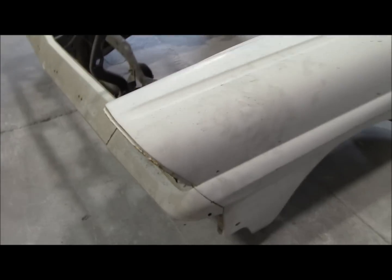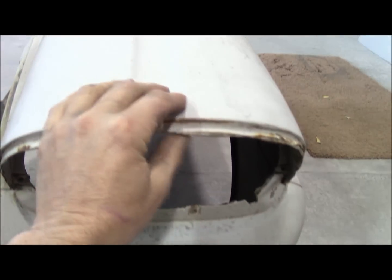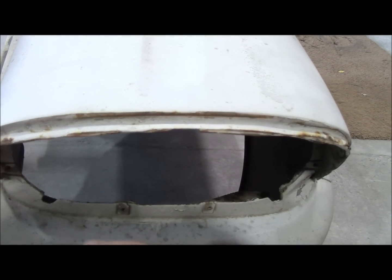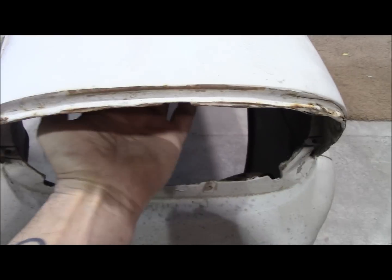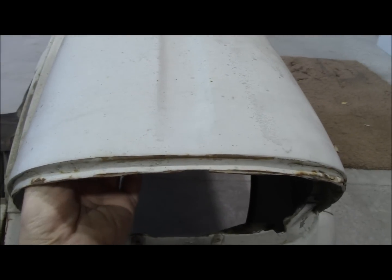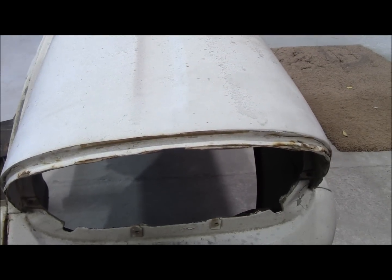What I was going to say is that on the fender itself, on this fender cap, like 55 Chevys and 57 Fords, it's double walled here. You've got your outside fender skin, and there's a lip under here that probably goes back a good two to three inches. It's solid open, so all the dirt comes this way, packs up in there, sits, gets wet, and that's what rusts. A good thing to do, if you can, is take a piece of rubber or something. You don't want to seal it off tightly, because if you do and water somehow gets in there, then you've got water trapped in.